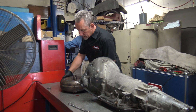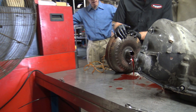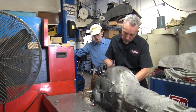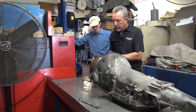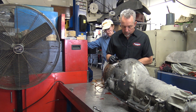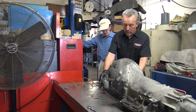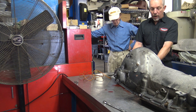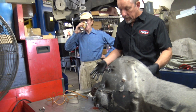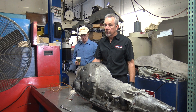As you can see this is a big unit - first of all it's full of fluid. Watch when I do this you'll see it comes out. And you think, okay, if I just turn it upside down it's going to drain - it will not. It's only going to drain to a point and then it's going to stop. When you flip it over the fluid's going to sit in here instead of coming out. So you can use a siphon to get it out. These are sealed units - if you look here there's a big welded bead. I already have a rebuilt unit right there. What they do is cut this bead, go through and clean it out, make sure everything is right, then weld it together and balance it. So these are not serviceable by a typical place - you have to have specialized equipment.